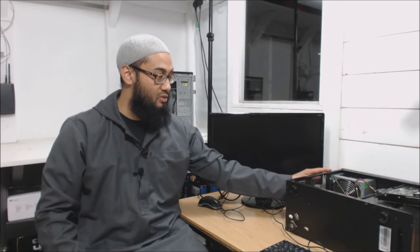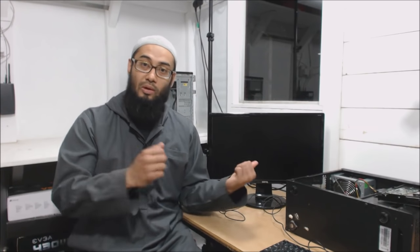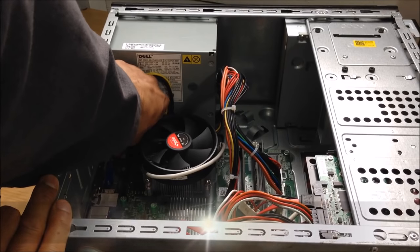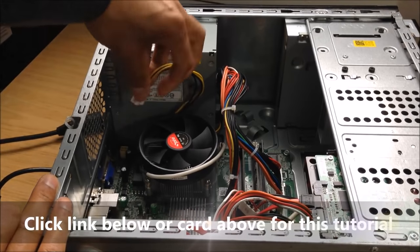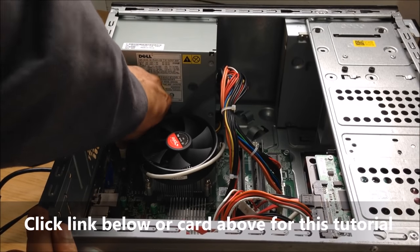So while this is booting I'm going to talk to you guys. What happens is, although in this case we have a power supply which is turning on - there are some LED lights, the CPU fan is turning on - but because there was no power coming into the CPU pin, it looked like it wasn't turning on. Similar to a previous case where we found the problem was that the CPU pin was plugged in the wrong way and it wasn't delivering the actual voltage to the CPU plug. So that could be the problem - not necessarily a graphics card issue.